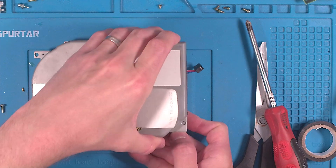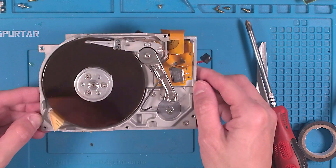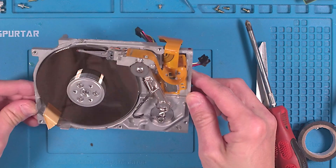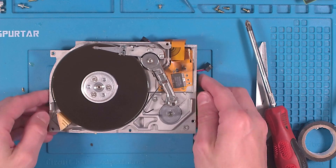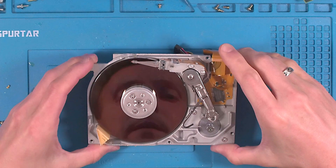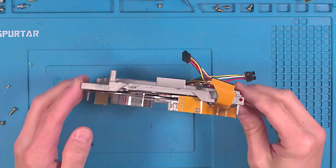Removing the lid — well, look at that. So this style of drive was probably before they actually auto-parked when being powered off, and I'm guessing over time the heads have gotten stuck to the disc surface. Having removed the sticker on the spindle motor hoping to get inside, I now see the only thing I can do is to remove the drive heads and finally then remove the platter. I'm trying to be as careful as possible, but as I said it didn't work before.